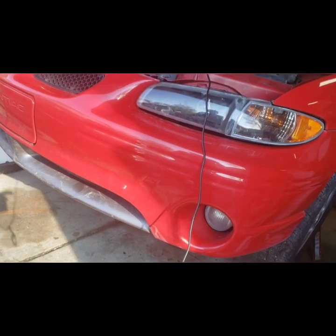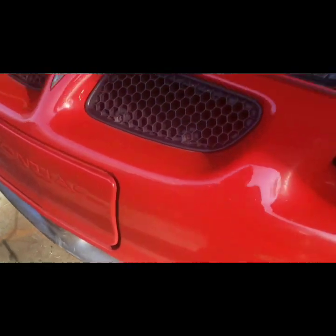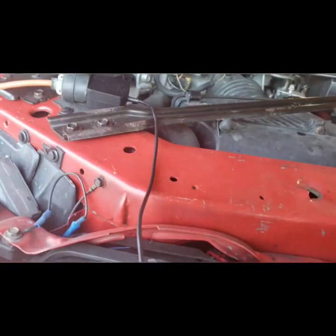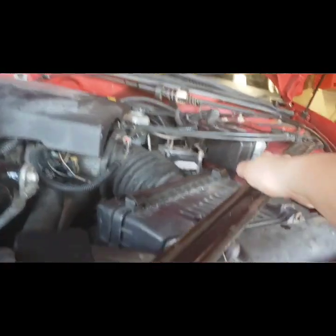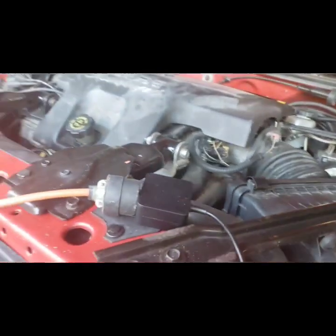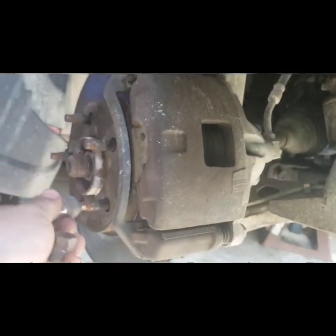It was weird — the car would only overheat if I started it and let it sit. If I drove it and then let it sit, it wouldn't. When driving, it would spin the fan and the fan would just keep going for the whole drive cycle. So I don't want that same issue — I'm going to do it the right way. Also, I messed up my brake booster when I dropped it, and now it leaks, which is fine because I have to use a Monte Carlo brake booster for this swap anyway, or else the clutch cylinder won't clear when it mounts to the dashboard.